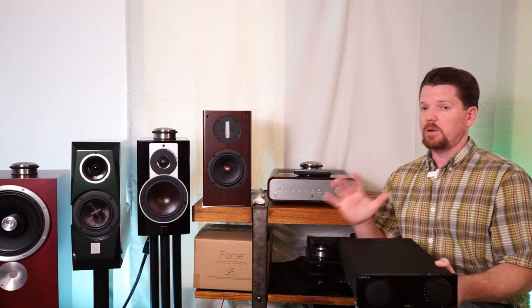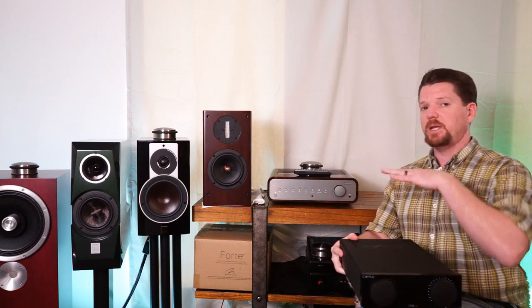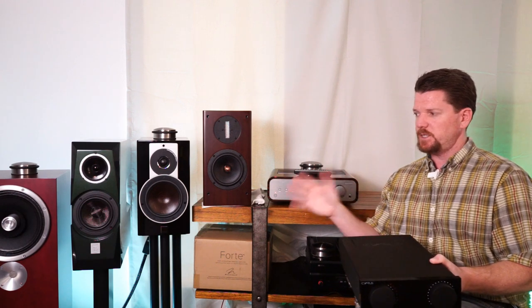When I used the Bluetooth DAC within the Cyrus by itself, I could hear a sheen — a little bit more brightness and edge. It satisfies most users probably, but when pushing it harder with my speakers, that brightness was noticeable — it wasn't there when using the higher-quality internal DAC and hardline cables. With both amplifiers using their internal DACs, the playing field was so level I could not find any real noticeable difference. Both Class D, similar power implementation — this was the hardest review I have ever done.